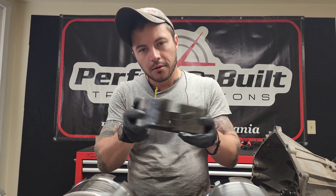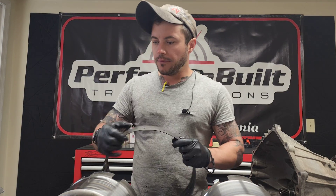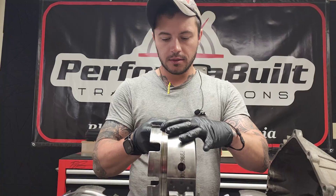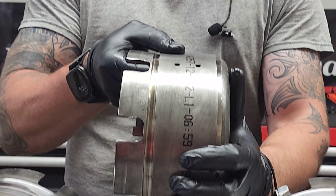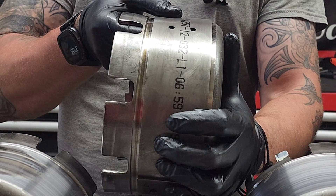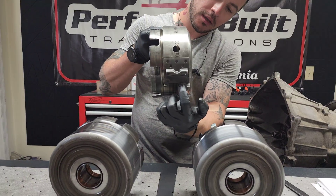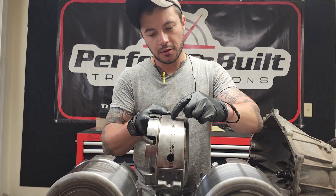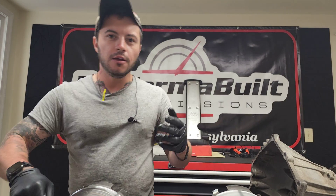The reason why they're not flat: this is an OEM band. It's pathetic — it's thin. It's like two and a quarter. That band does not utilize the full surface of the drum. So the harder you're pressing the gas, the more pressure is being applied, and that little servo pin and little anchor pin is putting so much strain on this center, and there's so much heat from it.